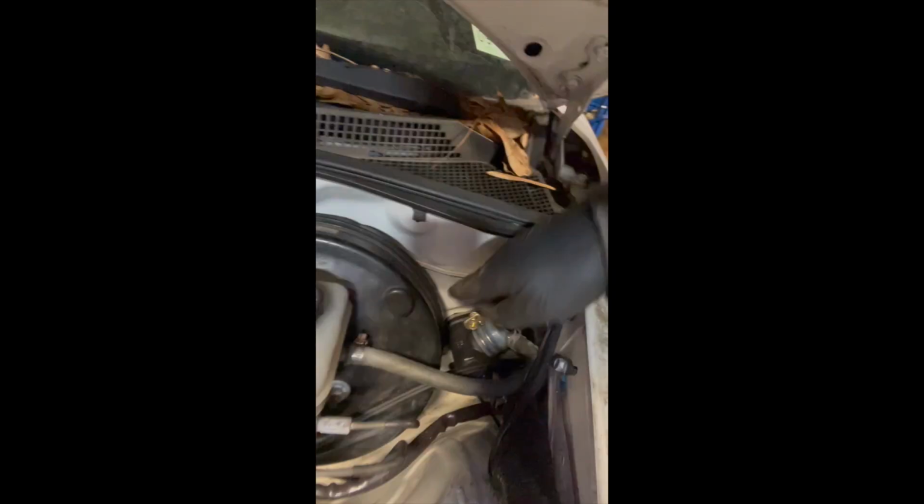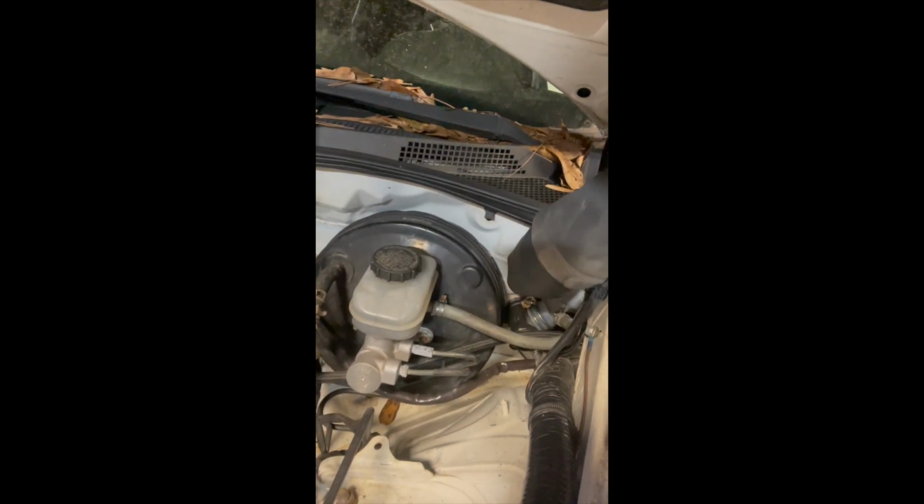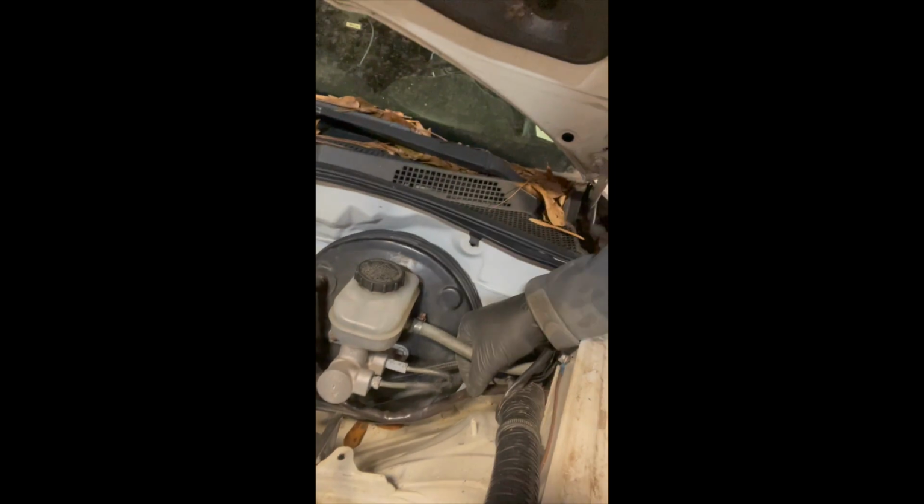This is also our clutch kit for the clutch master cylinder. So we have our clutch spacer, and then you use the bolts straight through. It bolts straight from the clutch pedal assembly in the car. And then we have our adapter for this specific one that goes to the clutch line, and this is because of the clutch line design. I'll talk about that more when we get underneath the car.